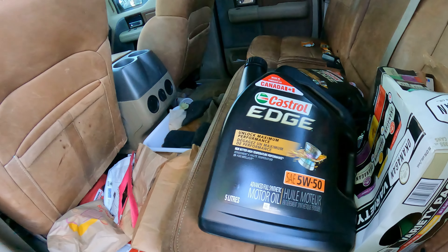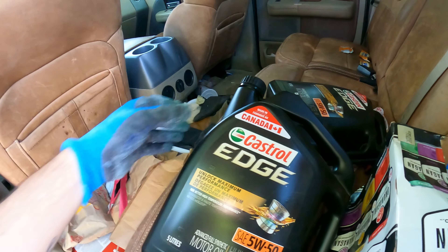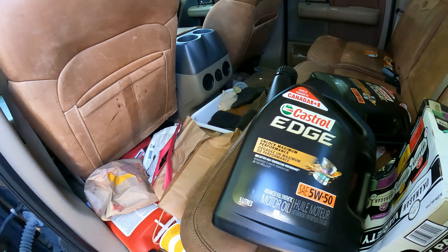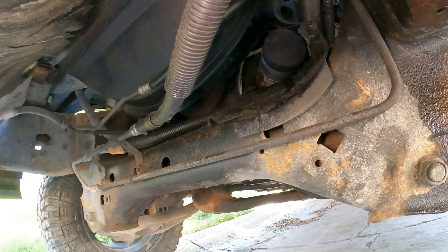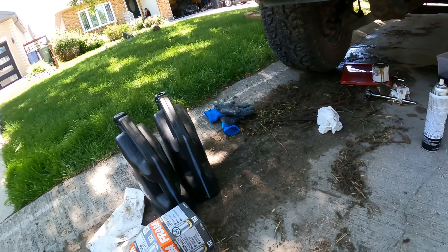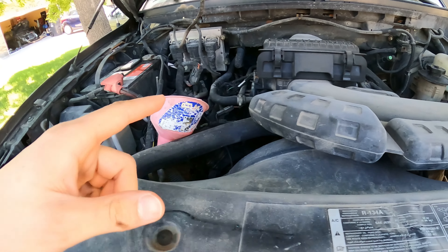It's summer now and I'm putting in 5W50 — recommended to me by Fred. It's going to take about seven liters or seven quarts, roughly the same. We've got our oil filter too. I'll pop the hood and show you guys where I replaced those other parts. During the oil change I put our new filter on — old filter out, new filter in — and now I'll fill up.